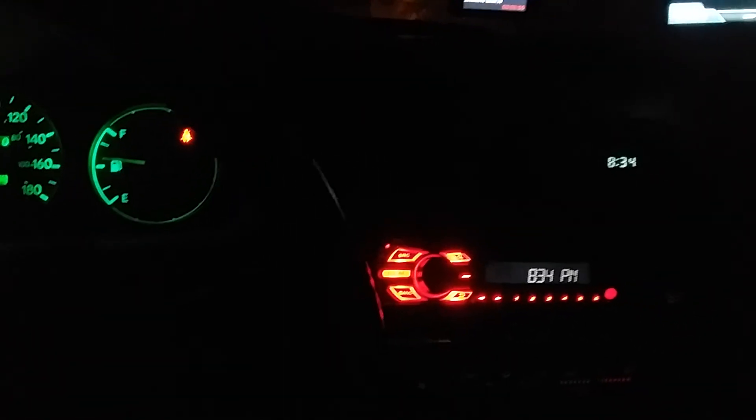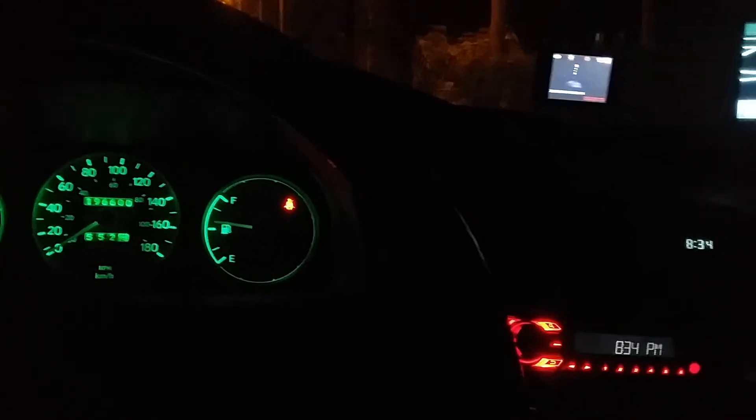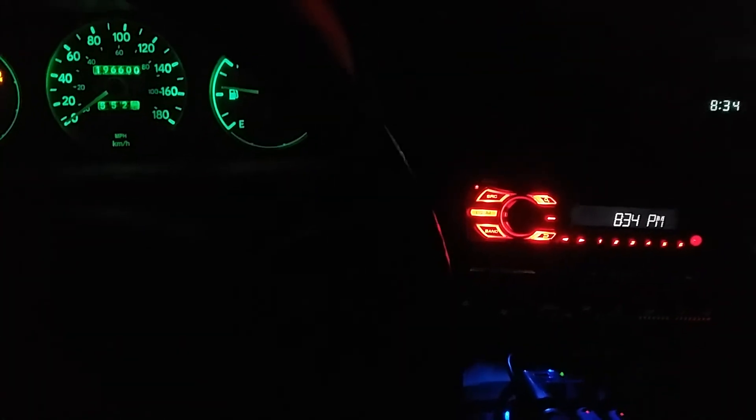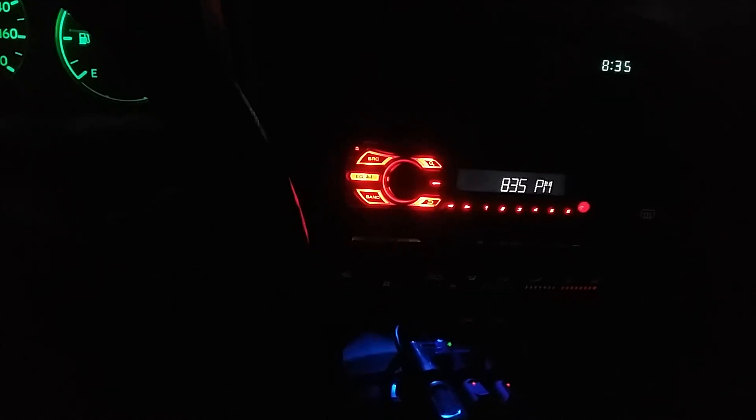As you can see I can play some loud music with that radio — it really comes through the speakers clearly and loudly. These are Bose speakers from Amazon; I think I paid about $100 for four speakers. They're rated for 300 watts max, and the radio is rated for 100 watts, so I can easily drive them. The original factory speakers were rated for about 80 watts, and their age made them pop.